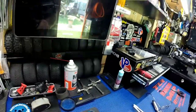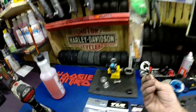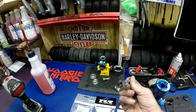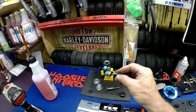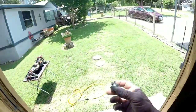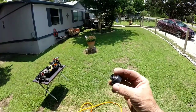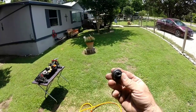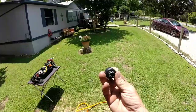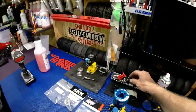Going through the Pico, breaking it down. Looks good. No corrosion, no nothing. This is the modified Pico Boost. She looks good, people. But the other day when we were doing the speed runs, at the end of the speed run, it shut down on me. And this is why. Two of the engine mount screws came loose. And thank God it didn't mess up the lightened spur gear, but it toasted this bell. Look at that. 14 bell. Gone. Hold on to it for mementos.